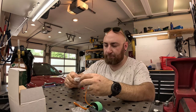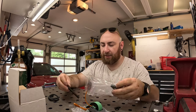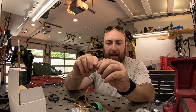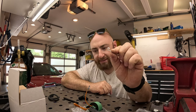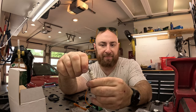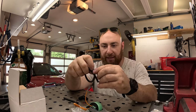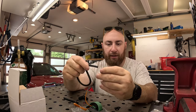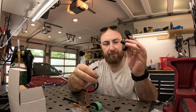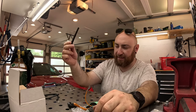The coils are basically one part with the spark plug wires on this kind of design. In our little bag we have a boot, and this kind of spring clip — these spring clips are an old school way of doing this. It mounts to the head of the spark plug. You can see these are our old spark plugs with a pretty big dome up here. These two little teeth need to pierce the spark plug wire and go into the metal core, so in the end it'll look something like this going into the boot.